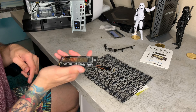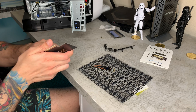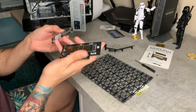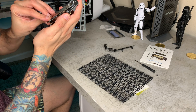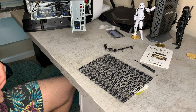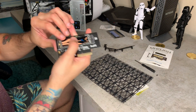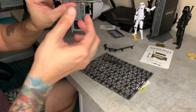To install the NVMe into the adapter, loosen the Phillips head screw first. Then line up the notch on your NVMe with the notch on the adapter and slide it in — you might have to go in at a bit of an angle. Make sure it clicks in so it's properly seated. You'll hear a little snap and it holds the drive up at an angle — that's what you want. Now hold it down and screw the Phillips head screw back in. Snug, but don't over-tighten.